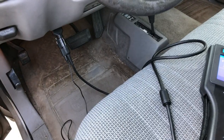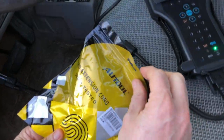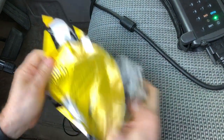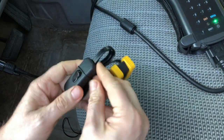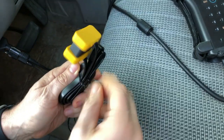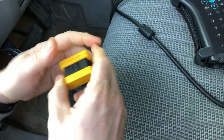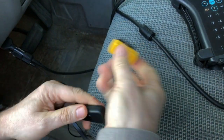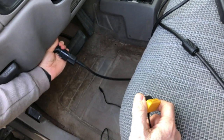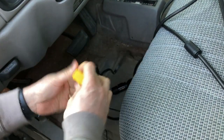So how can you fix this problem? I found a pretty cheap way to do it — I picked up one of these on eBay, and I'll link this in the description. I picked up one of these extension cables, and all it's got is a switch in it. The whole point of these is if you're going to use one of these OBD2-type things that feed into your smartphone, you don't want to drain the battery, so they have these little cables with a power switch on them. I'm going to use this cable in between — it's got a female on one end and a male on the other end.